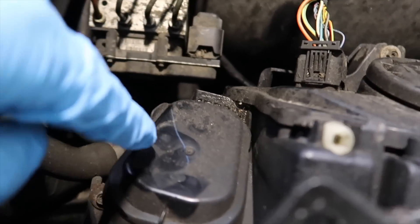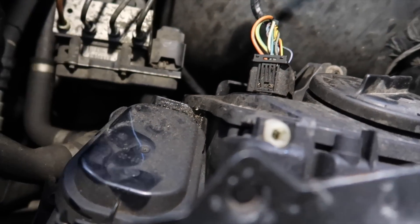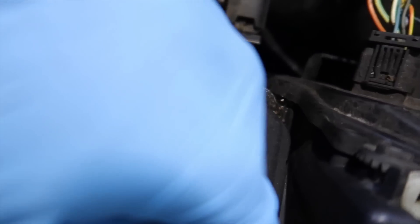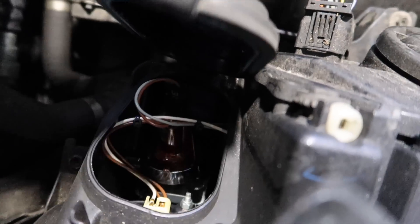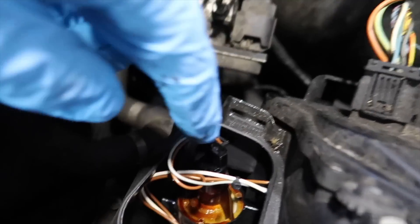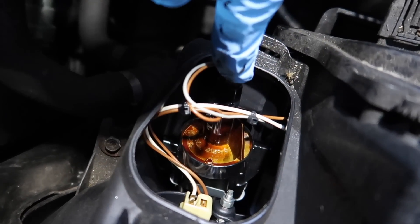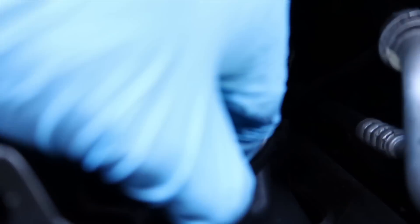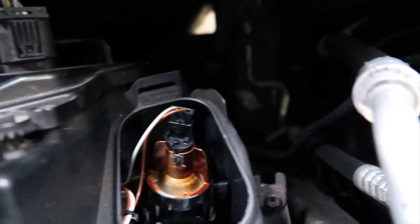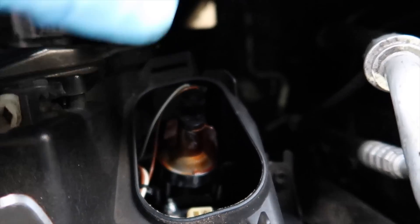This is the bulb socket you're going to want right here — this is the passenger side in the UK, which would be the driver side in the US. You just pull this flap down like that, then grab the casing and pull it somewhere safe on the top. This is the bulb you want to remove — the sidelight one right here. It's the same for the other side: press that tab, pull it down, and you've got access to the bulb. That's how you get access to the side light bulbs.